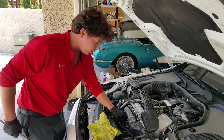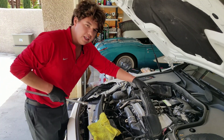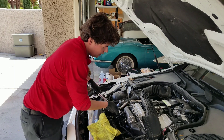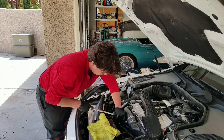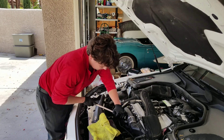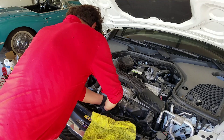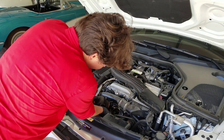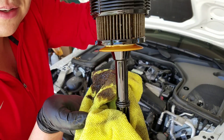Now we're going to take off our oil filter — it's right here in the middle. You just snap off this little plastic duct that goes into the intake, then pop off the top panel; it just pops on and off super easy. We got the big breaker bar to pop off the oil filter — easy as pie. This is a one and one-sixteenth socket, or a 27 mil. It's not on very tight, it's all 25 newton meters. And there's our oil filter.